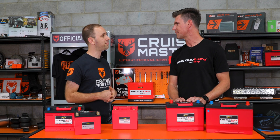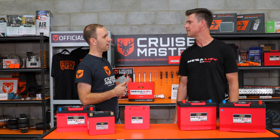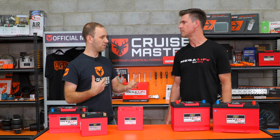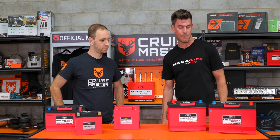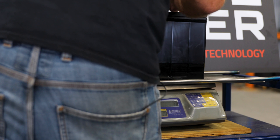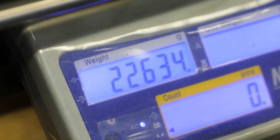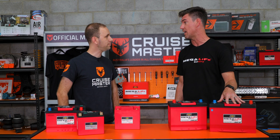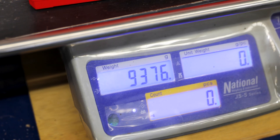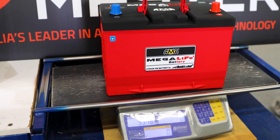These batteries are really proven now — we've done a few in 200 series, which have issues with front axle capacities, so there's an obvious benefit in weight with lithium. In terms of weight, we're getting about a third of the weight per volume compared to a regular AGM or lead acid battery. Something like this N70 in front of us is about 28 to 30 kilos in lead acid and we're seeing it at just under 9.5 kilos — basically the chemistry difference of not using heavy lead and instead using lightweight lithium.